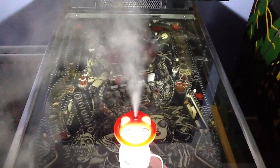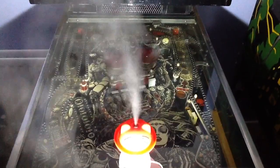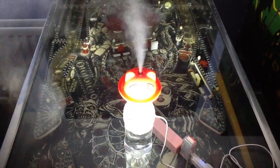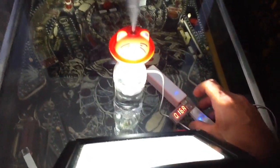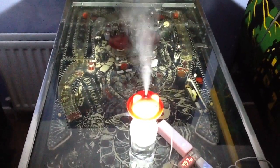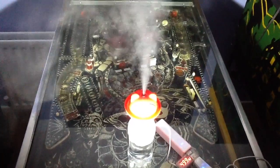This video starts with the backdrop of a pinball machine to show just how much fog comes out the top of this little critter's head. This is a humidifier that pushes into a drinks bottle as a water container and runs off a USB power supply. The actual power it's drawing is minimal — just 170 milliamps. Look at the amount of vapour it's actually atomising ultrasonically. Let's take a closer look at that right now.